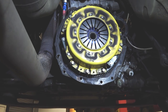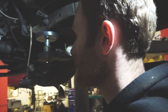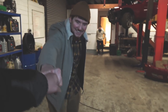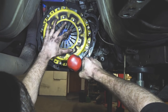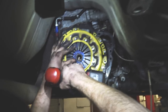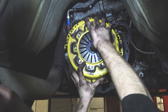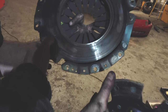It's always been advised, well you're meant to replace flywheel bolts every time - not many people do, but you're definitely supposed to. That's all the clutch bolts now removed, should be a case of just pulling her off. Woo, Wayne's been doing burnouts! Definitely a few clutch kicks in there, man. It's pretty fucked.